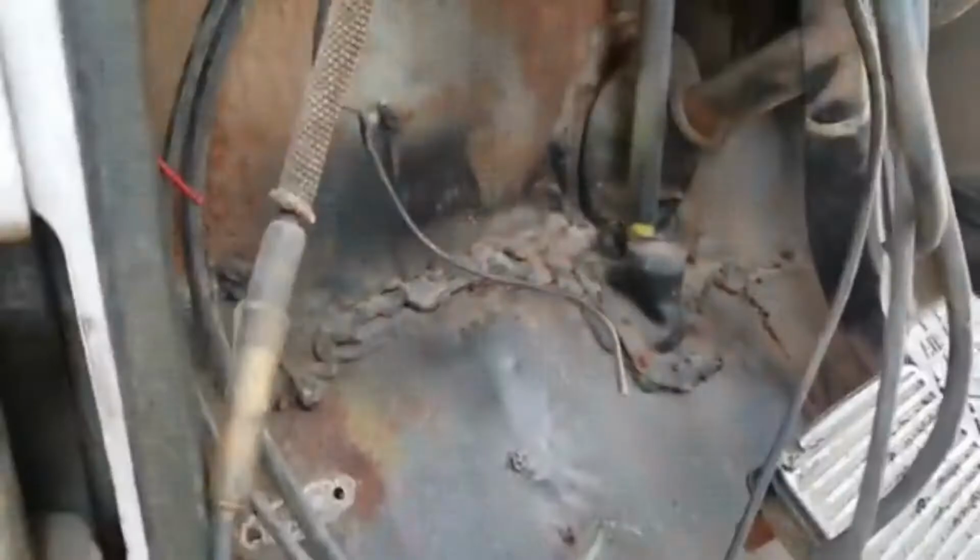And the second thing that I did was I rechecked all the oil levels in the differential and the transmission, and re-greased the joints. There are greasable joints on the springs and the drive shaft. But what was really bad about it was the cab. The whole floor was just rotted out, as well as the exhaust. Again, I don't like to see the rust, and I like to get something solid, so that was the main job. Mechanically, everything is fine. So the two main things are the exhaust and the cab. Otherwise, everything is pretty much good to go.